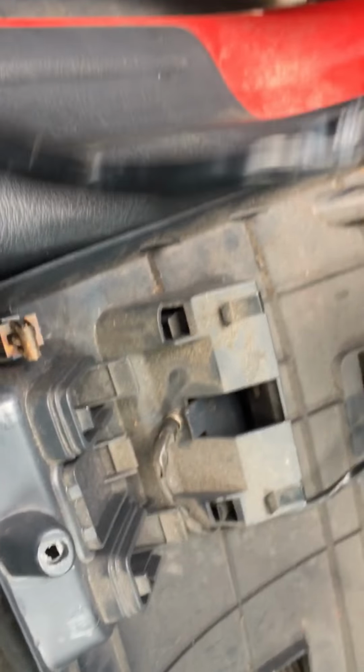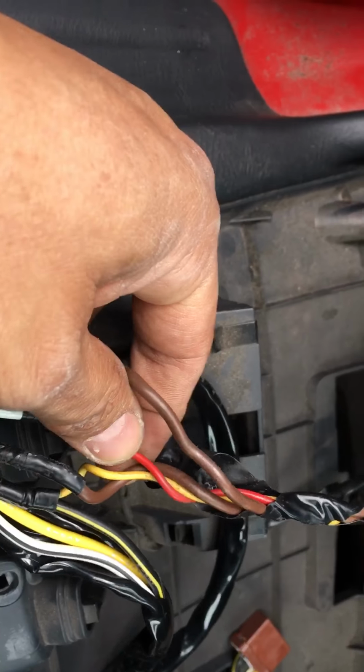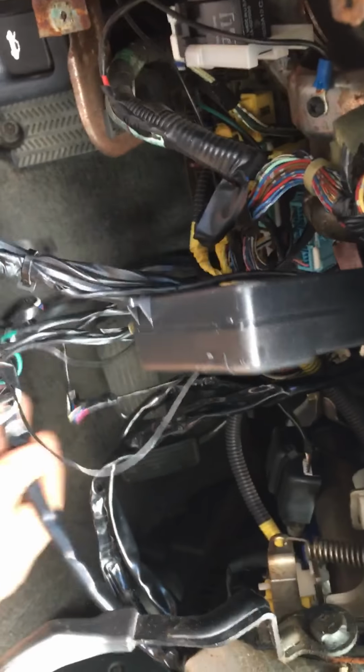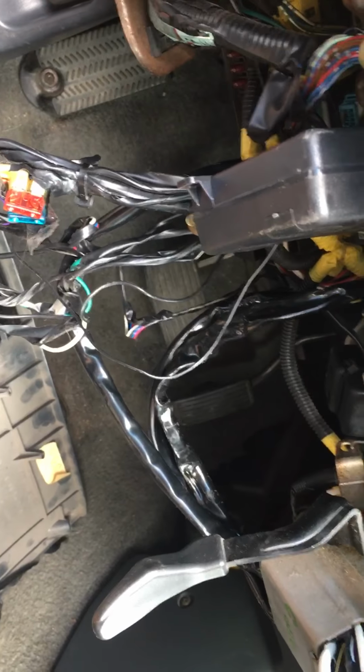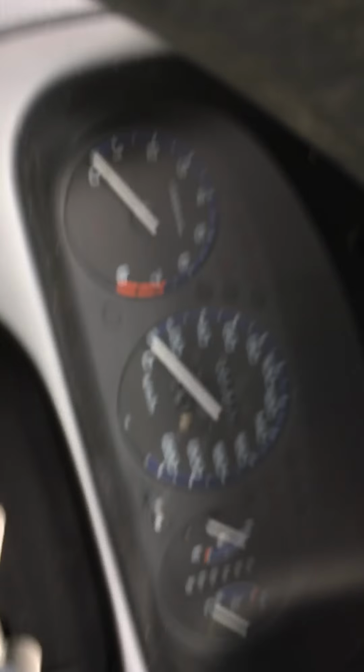So my hesitation right now is the following. This particular vehicle is kind of with an immobilizer. So I'm just looking at the old harness in here for the immobilizer, and I'm really tempted to bypass the harness altogether, because although it's rather simple to undo and redo these things, I have tested the unit directly. So I just plugged the new harness right here, 1 and 2, directly to the circuit board in the vehicle. And I'm just gonna show you something really quick.